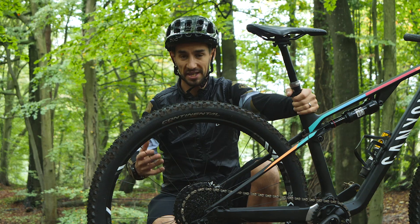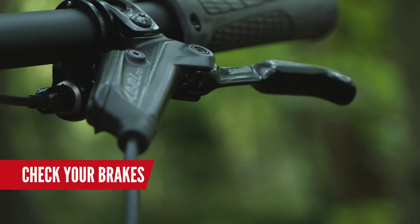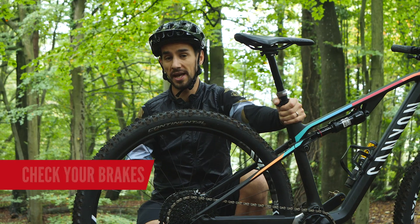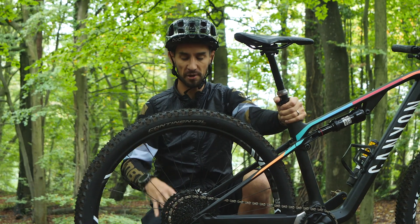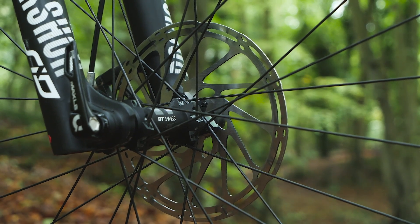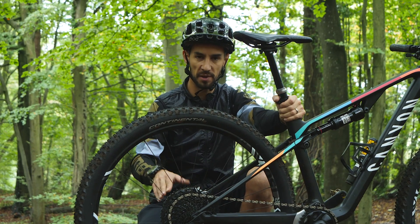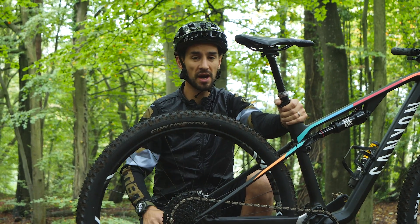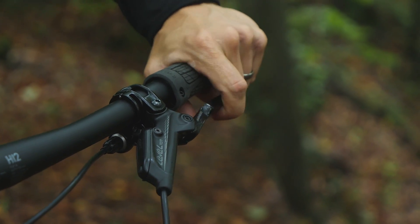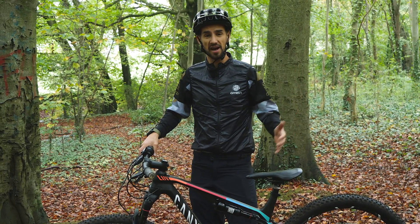Lastly, but an obvious one, make sure the brakes are in tip-top condition — they're the most important thing on the bike. Things like squealing and warbling could be caused by oil on the rotor, and that's really common to get some on the rear rotor from lubing your chain and getting a bit of overspray. Make sure they're working really well and you can use just one finger to stop your bike, so you're using the rest of them to grip onto the bars. That's the bike setup — no excuses.